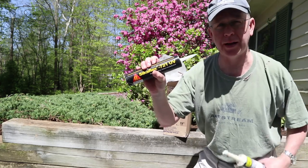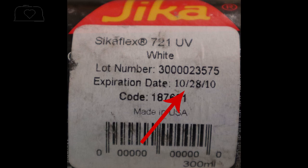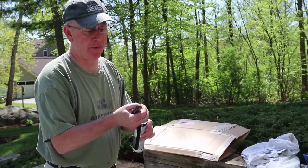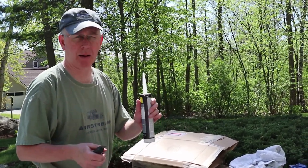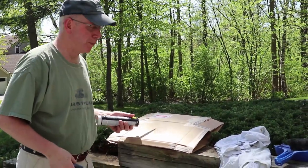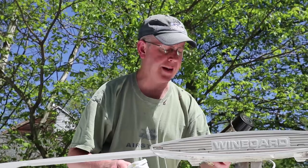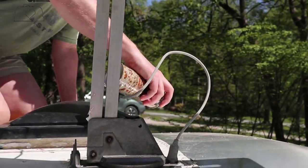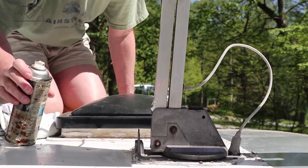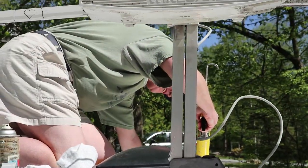Here's my old 721 UV — they don't make that anymore; it's been replaced by the 505. Make sure you check the expiration date, as most sealants have one. We're going to start with a very small cut at the application nozzle and begin sealing the front cap seam first, before going around the fantastic fan. We'll do a few practice lines first to get used to it. Before applying the sealant, we'll use Citrus metal cleaner and maybe some Simple Green to make sure the surfaces are entirely clean and dry.